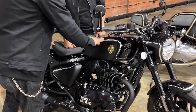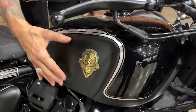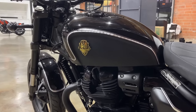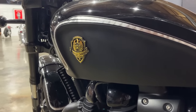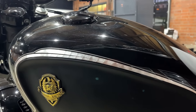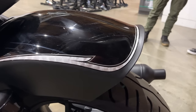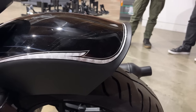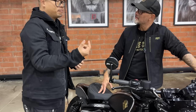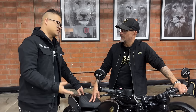When you look closer, there's actually like a wind — like a feather kind of design into it. And you also scalloped the tank, which is beautiful. Basically, you look at the line, and you look at how the light reflects, and then you decide where to cut it. So it's actually cut in two pieces. When I cut it out, I cut another steel strip and weld that strip to the piece that was cut out — so it's like this piece got a step, like a side wall around it. Then you've got enough material there, you put it in, decide how much insert you want, and then weld it back and cut off the rest.